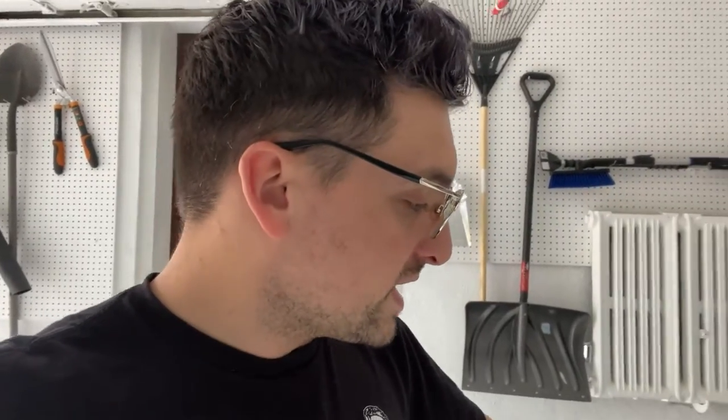What's up, guys? Now that we got these honed, we're gonna go ahead and clean up all the RTV off of all the mating surfaces. I'm gonna do that now before I start putting things together, just in case dust particles or anything get inside the engine, we can blow those out and everything will be perfectly fine. So I imagine this is gonna take me quite a while because three out of the four sides of each of these case halves have sealing surfaces on the mating surfaces that are covered in RTV.